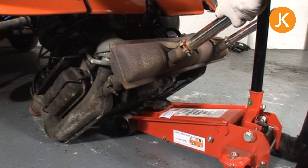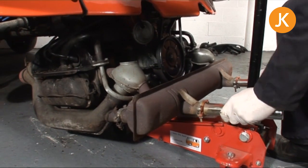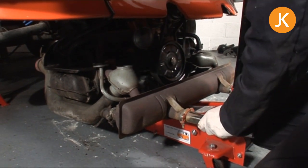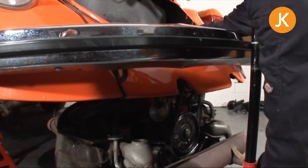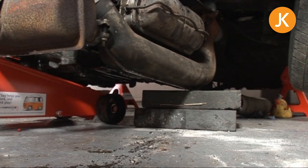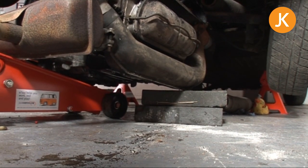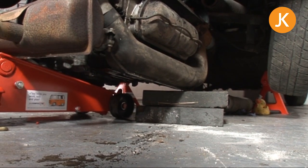Wedge the trolley jack with your feet and then pull down on the tailpipes to lift it over. Then once it's up you can slide it under a little. This is why it's so important to have a smooth runway underneath — so if you've had to use a bit of board, fair enough. Then just give it a little wiggle on the trolley jack. You don't need massive strength, just balance it and give it a pull. Now if you've found that the cup is not exactly on the sump plate, use a couple of bricks or preferably a bit of wood because it's less likely to slip around. Then you can just lift it up a little and push the jack under a bit more. Do that until you're absolutely sure of the balance.